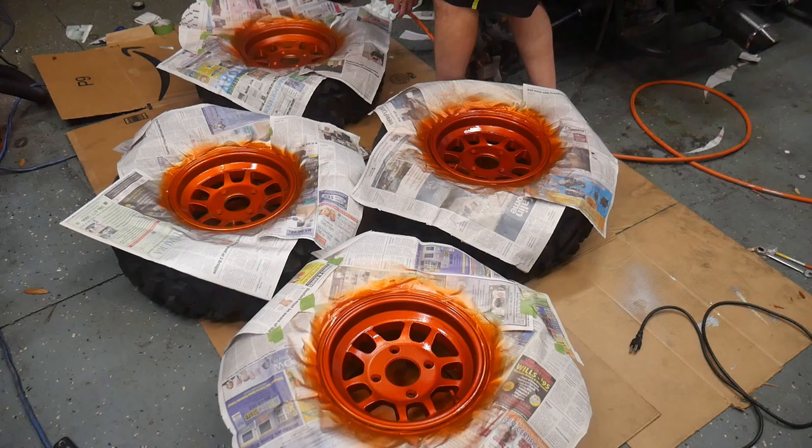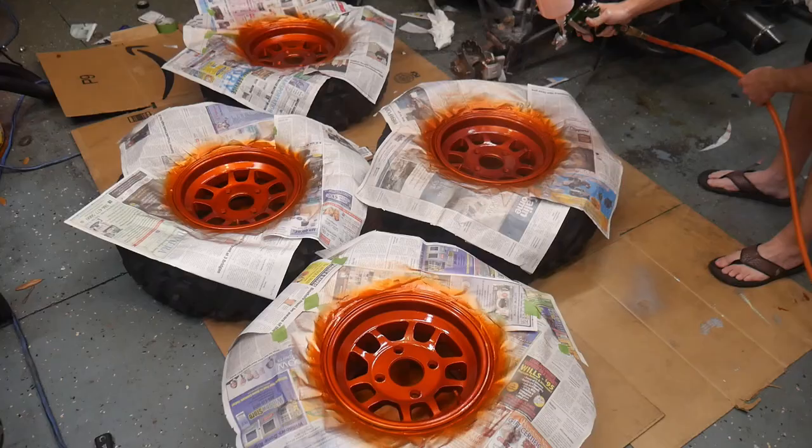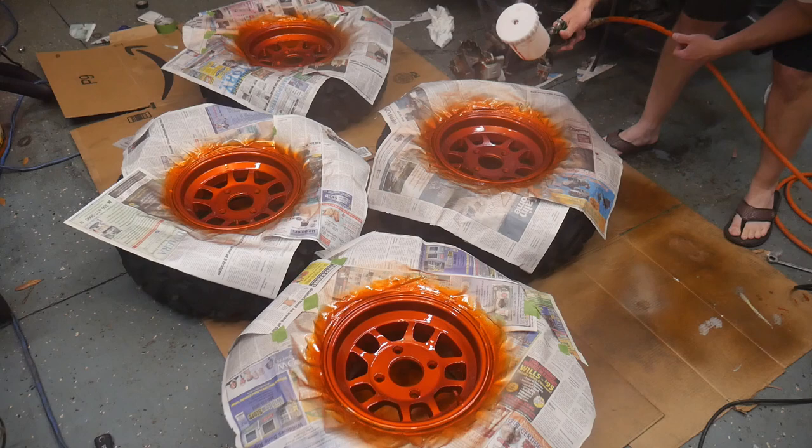Look — I found the footage of my final top coat being sprayed. We're finally on the last step. What I'm using is Custom Paint's 2K Show Clear and Activator. I like to use about three to four coats of the clear — you can use more or less depending on your application, but this is what works for me. I allow just enough time in between each coat of clear to where it's no longer tacky.